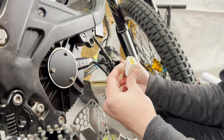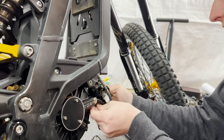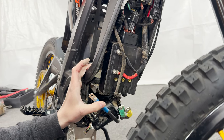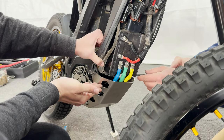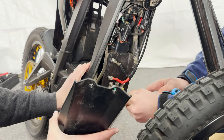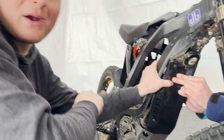Your next step is to plug your new motor encoder sensor into the existing plug — it is plug and play. Plug right in there and tuck it up nice. We may zip tie it back closed to keep it all clean. Now we're going to connect our three motor phase wires: blue, yellow, and green, going to the same B-G-Y terminals on the controller using the existing screws. Now that the phase wires are all connected, the encoder is plugged in, and the skid plate is back on, we tuck everything in, put the Torp TC1000 cover back on with the two top screws, put the battery back in, and go ride it.